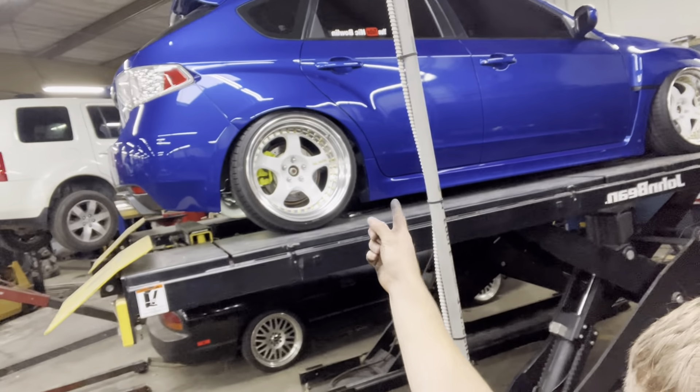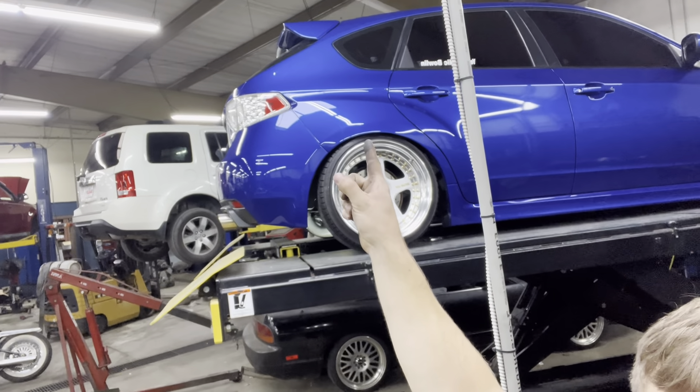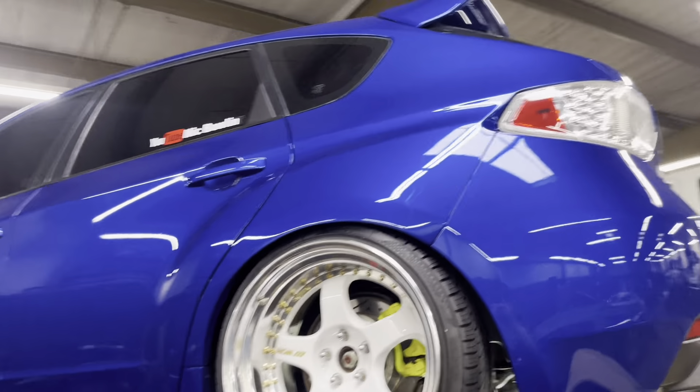As I brought the camber out in the rear it actually raised the car like two inches, which is super weird. So there's a huge gap now and that's with the strut at zero psi. I've got control arms on the bottom — they're fully adjustable — and the upper control arms we just put on. I wanted to bring the lowers in to take stress off the CV axles. Before when I aired out it was just yanking the CV axles out of the hub. I'm sure everybody with a Subaru that wants to go dumb camber has run into this going uppers or lowers first. It's got like an inch and a half to two inch difference now from when I had the razor, so I gotta lower it back down. It's just back and forth.